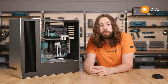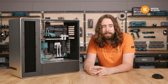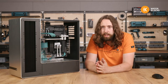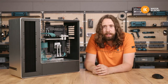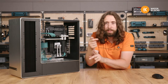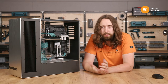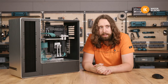TG, yeah, I'm sure you'll have a great time with the FE active backplate. It's really special, and you can even configure it a little bit. There's a plate inside which you can switch the direction of flow, and they run in sequence, and you can use two ports on the end or two ports on the side or one of each. So I think that's the best of all worlds. Now it's made in two pieces on the FE. Obviously had to be special because it's an FE.